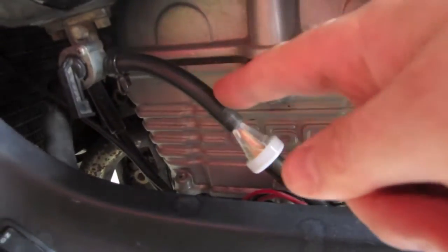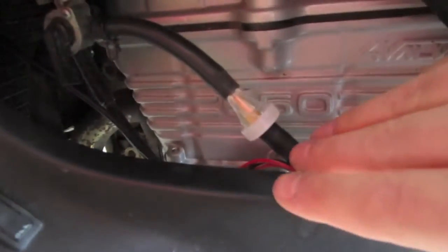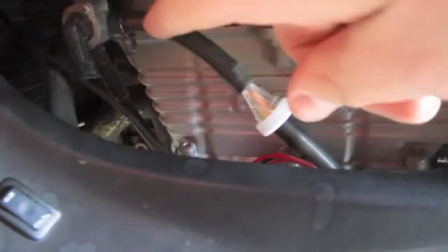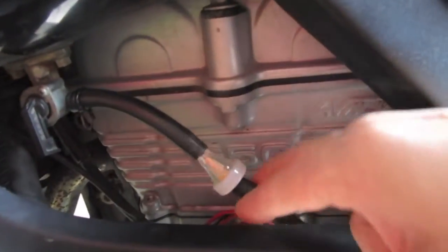basically take the fuel line off and blow into it, and basically there was sort of an air bubble in the fuel hose itself. So sure enough, took it off. I just could feel the gas moving, and probably went into the bowls of the carb, and then put it back on and made sure fuel was coming out.